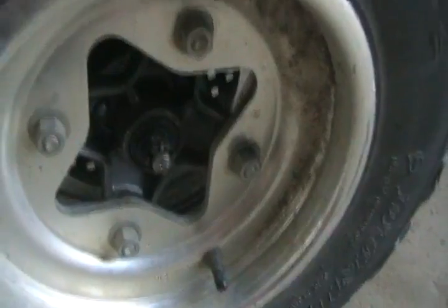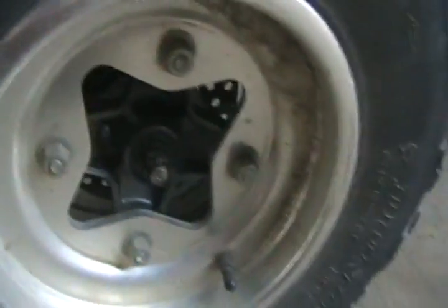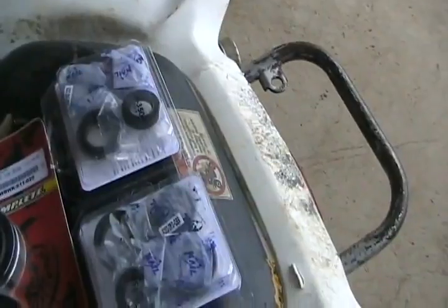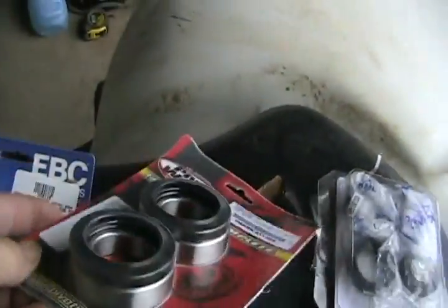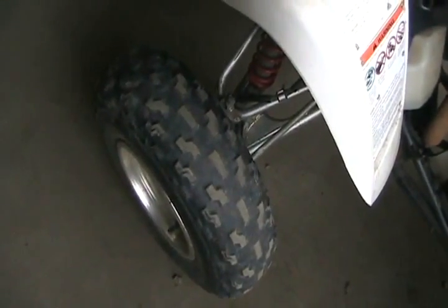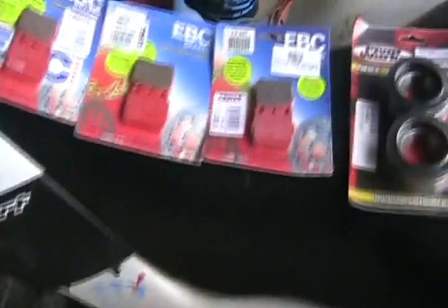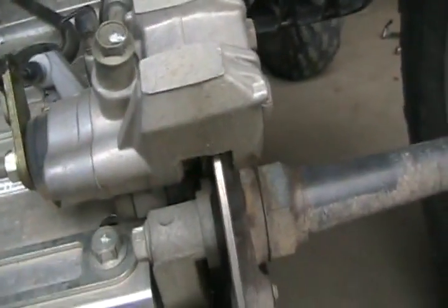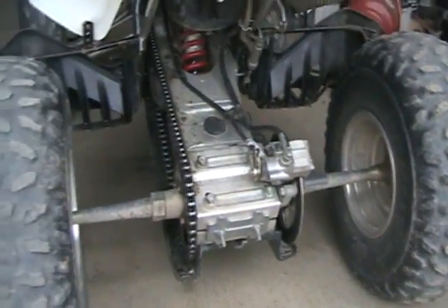Let's see how to do it. The front bearings are pretty simple, but you can just see how much the wheel clunks and wobbles around. There are the rear bearings and seals we'll be putting in in a minute. When a bearing's worn and the wheel is sitting crooked, it moves the rotor crooked, so it wears your pads out on an angle. So I decided to put all new front and rear pads since I hardly have anything left on those pads - not even a millimeter.